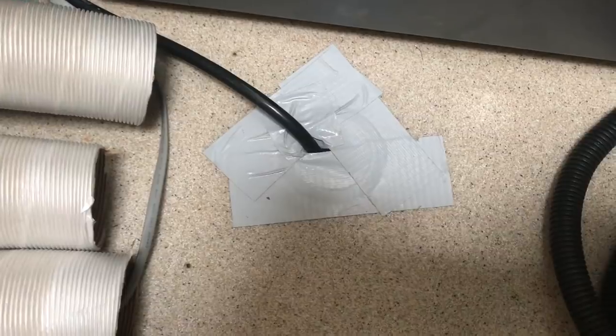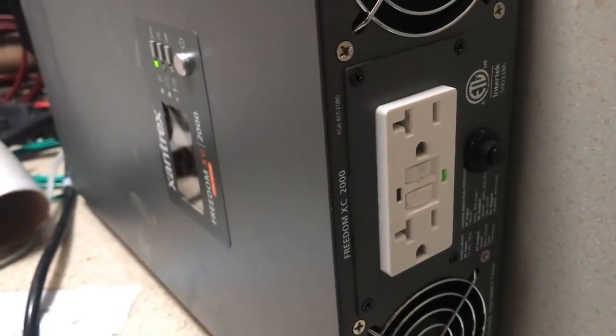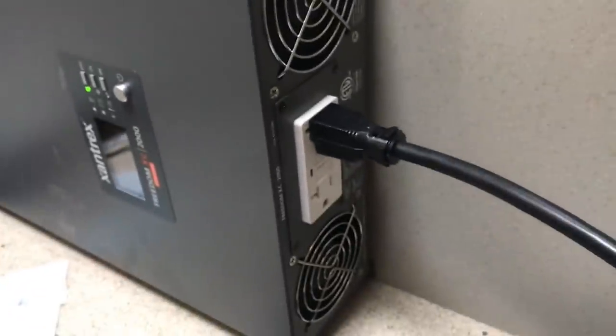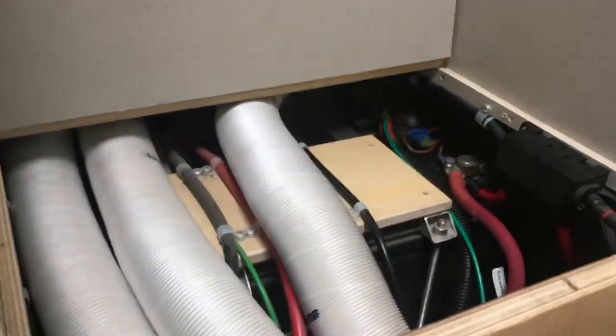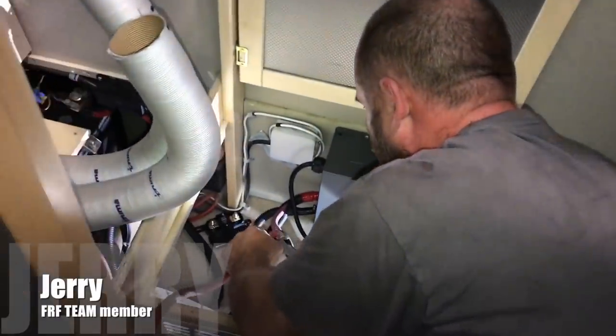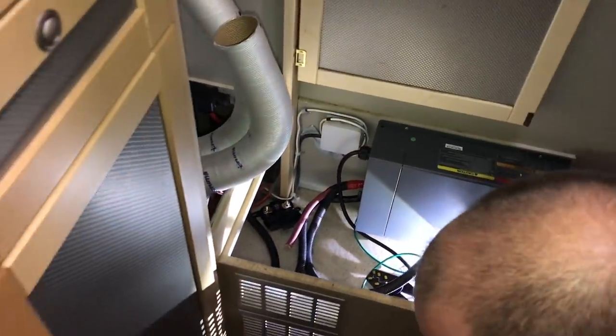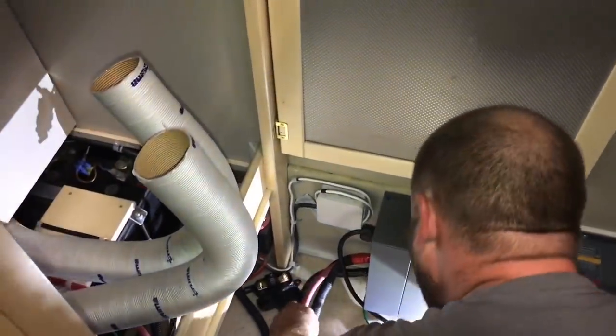Back to the charger — the cable I just showed you runs back in here. The charger is included with the inverter. From the inverter, we now have two 110-volt outlets we can plug into. This goes back to my batteries — two 210 amp-hour batteries — and here everything is hooked up. Jerry is now cutting the positive cable to the battery, and we're going to install the fuse in between because we want to be safe. Here in Canada they use Robertson screws — it's a totally different system — so I need to make sure we use screws that we can work with.